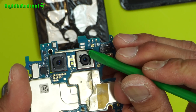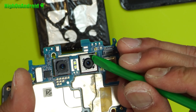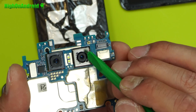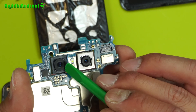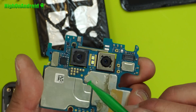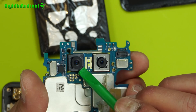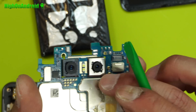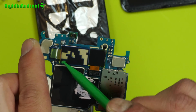This is the main camera that has OIS — that's how OIS works: the lens moves to counterbalance your shakes. Whereas the wide angle does not have OIS. Obviously it's a wide angle, so you really don't need OIS. But if you break these, you can simply pop them out and replace them — it's really easy to do.